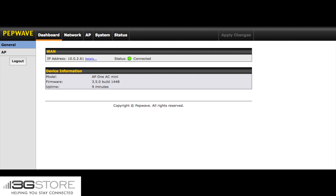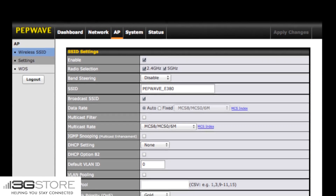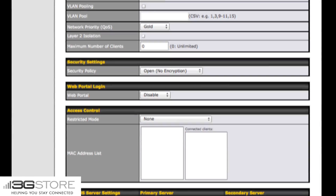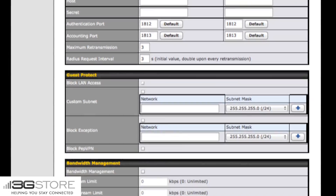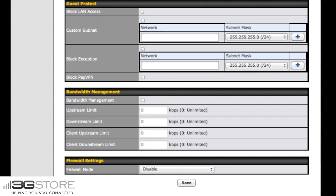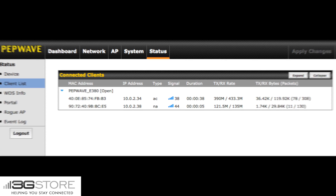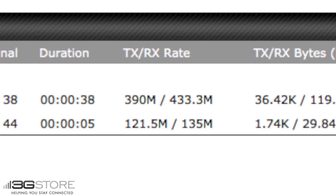Management of the AP1 AC Mini is also very straightforward. It uses a new user interface that more closely matches the current Balance and Max series routers available from Peplink. Just because the AC Mini is easy to set up does not mean it's lacking in features either. You can configure everything from specifics on the WiFi network, and there's even band steering, which will automatically decide what frequency a connected device should connect to and at what speeds. Once connected to the network, the client list will tell you exactly the capability of that device — the top device is connected at AC with a maximum speed of 430 megabits per that device's limitation.